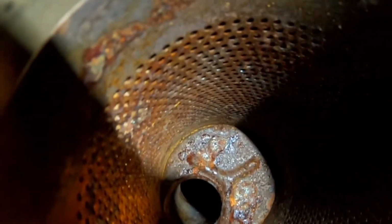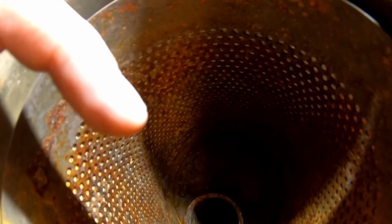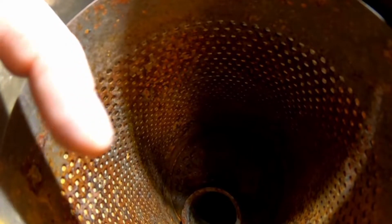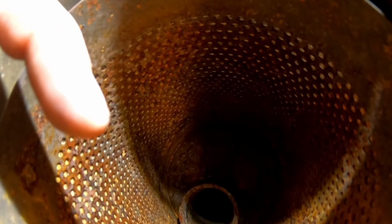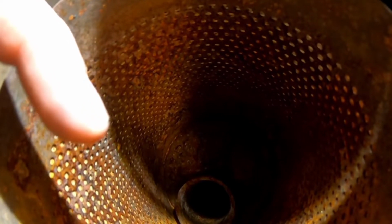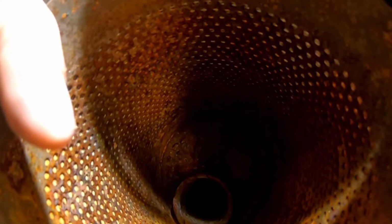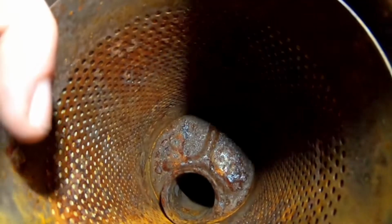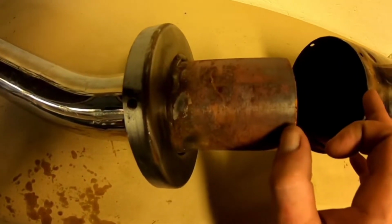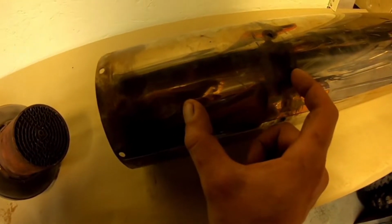So there is a wall inside. Now the cat would have recessed into there, so that chamber's now got that designed amount of flow. If you take the cat off and do it the same length as the cat removed, theoretically you're not changing anything from Kawasaki's specs. So you've still got the same depth first chamber, but you've got no cat in there. So that's your aim. The gases are going to be exiting here, which is basically that far within the can. So now you've got a chamber there that's that big.